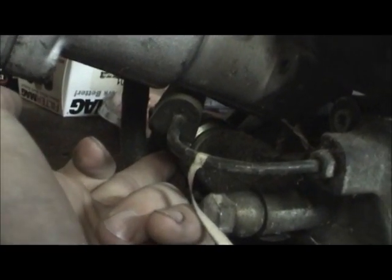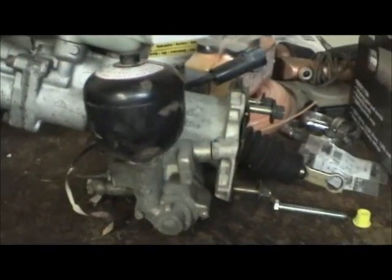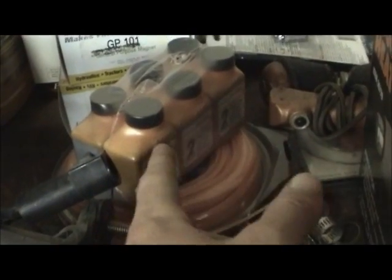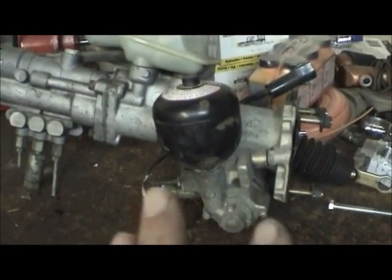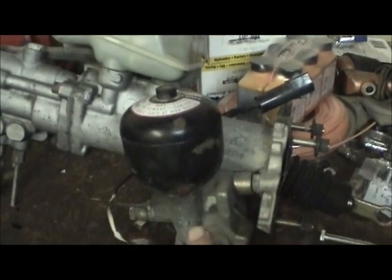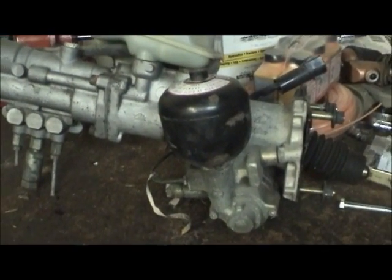When the pressure switch goes bad, it'll usually fail closed, and that'll make the pump motor run continuously, even with the key off. This is a critical safety item, so the power to the pump motor goes to a relay, but that relay is actually directly attached to the battery with a fuse link. That way, there's nothing getting in the way of the flow of current. You can have a bad ignition switch or other components of the electrical system going bad, but having it directly connected to the battery is your best shot at getting reliable service. So if the pressure switch is bad, the pump usually runs all the time, and that's your first clue.